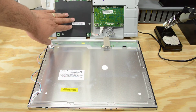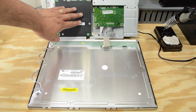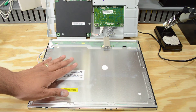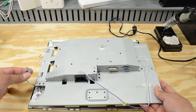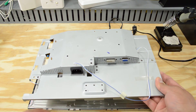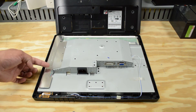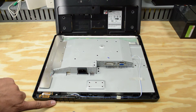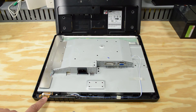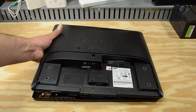Putting everything back together now. This piece here is the board I just fixed. The plastic part on the back is held in place with clips that protect the back end of the board against the panel. This part rotates down and sits like that. I'm not going to put it all the way down yet because I've got a couple of wires to hook in first. Now it's sitting in the plastic frame of the case. There's some shielding snapped in, as well as control cables — this blue and white cable routes over here and controls the menu and setting buttons on the monitor. The power button is underneath the front, and then you pop the plastic cover on the back, snap it in, and screw it in place.